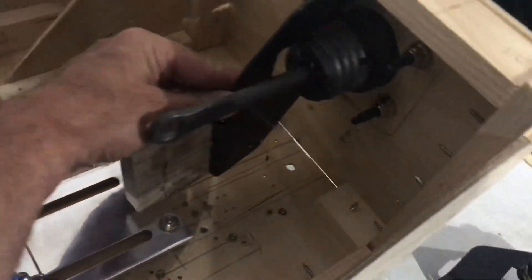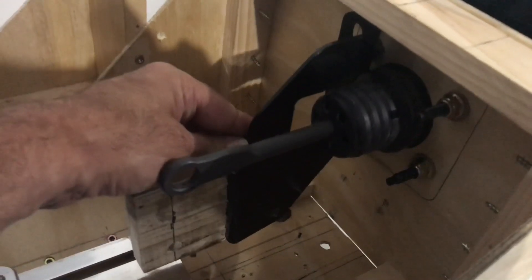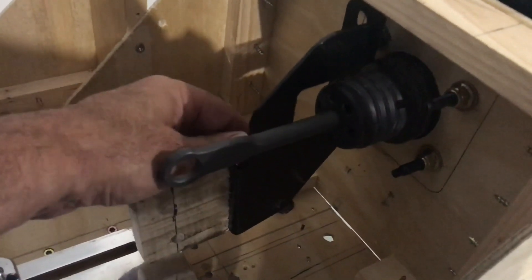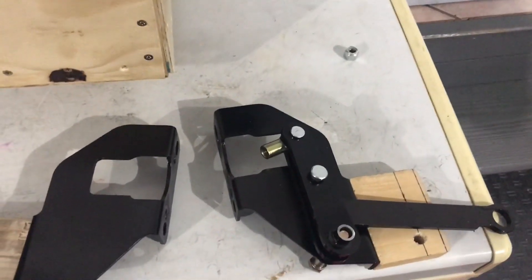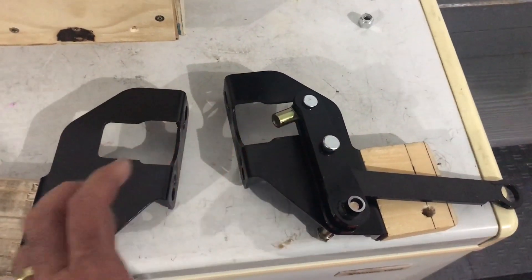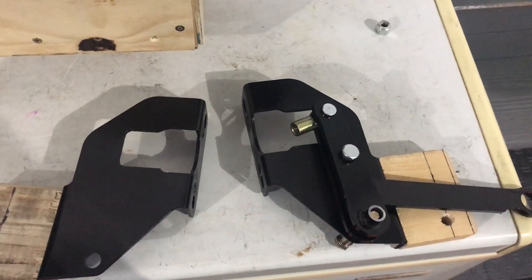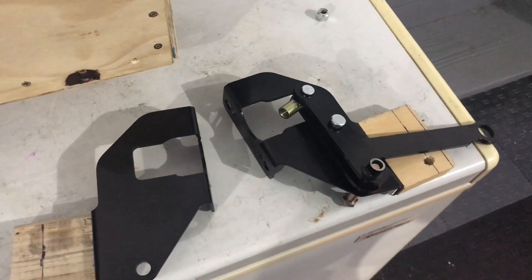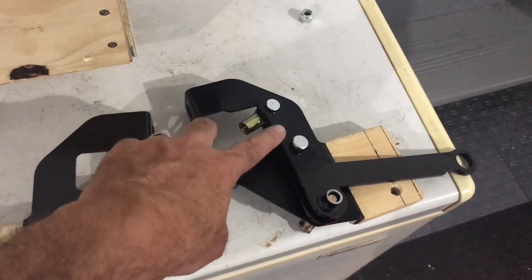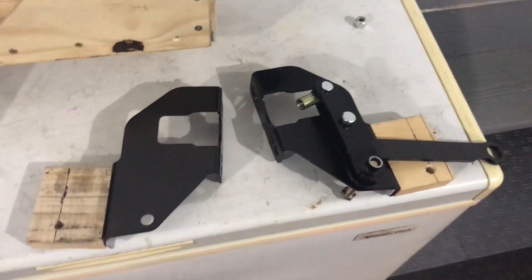When I mocked all this up, it just wasn't very stable — it shifted a little bit when you hit the brakes and didn't feel solid. So I decided to use a different approach but still use this particular lever. If the lever doesn't give me the ideal pedal ratio — maybe the brakes are too touchy or the pedal throw is a little too much — I can simply move the hole up or down, or fab up something slightly different and change the ratio. It's just simple math.